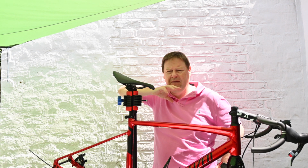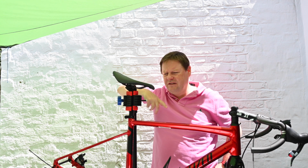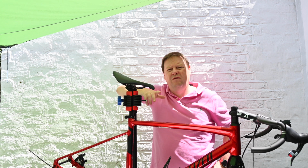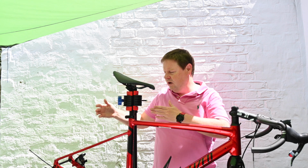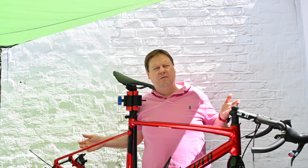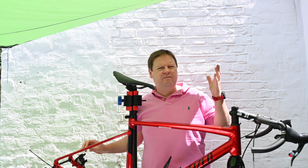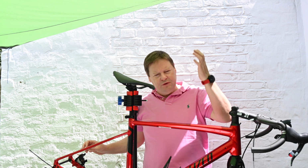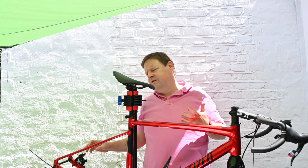So the problem I've got is I either have to go mullet again, which is just like going back years when you had to use Dura Ace and Ultegra with an XT or an XTR on the back, which just doesn't feel right. Or I go Force, and then I'm forced, again forgive the pun, to go 2x, because of the maximum cassette on this previous generation, and everything from the Apex, which is fantastic, $500 for a complete group set, 42T, and you can run quite a lot on it. The problem is that it's not quite enough, right?